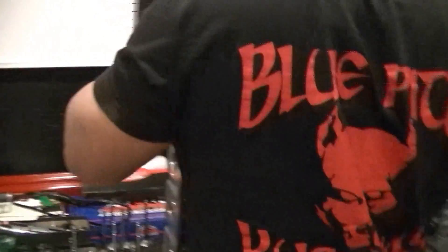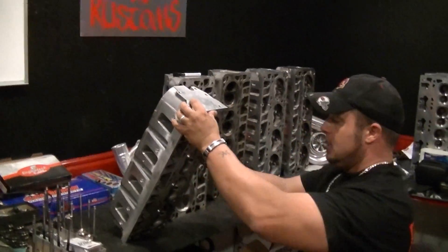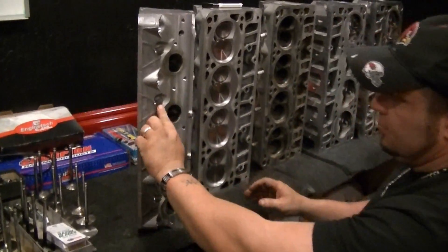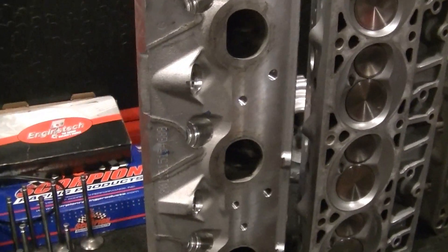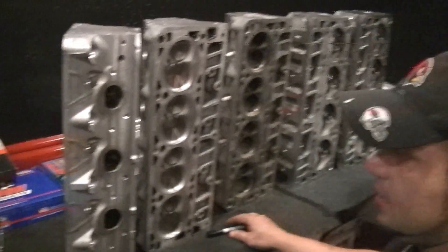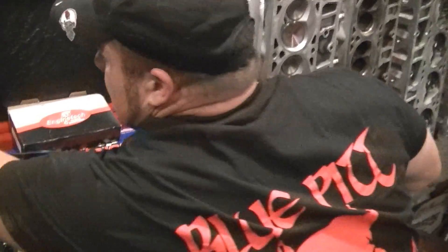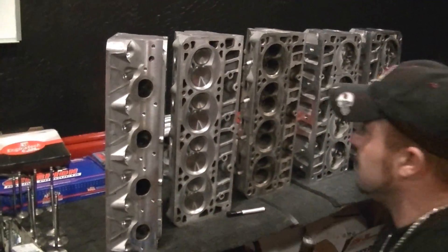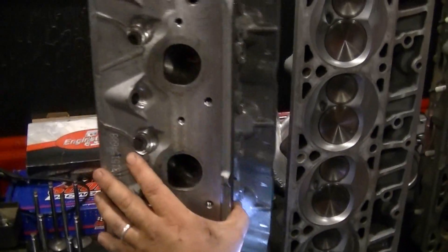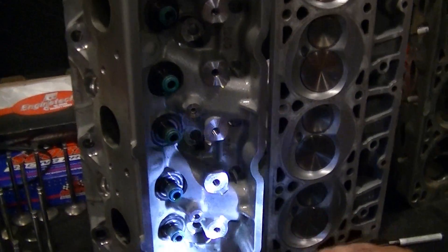Let me give you the identifying factors between an SPM cast and a sandcast cylinder head. SPM cast always have the triangles — the 243, the 7-series 48 head, even the LS3 heads — they all have the triangle cast into them. That's your first identification of an SPM cast head. Your second identification is how smooth the wall is. I ported these heads so you're not going to be able to see in there, but you can see how smooth it is — really smooth. The ports are just the same.